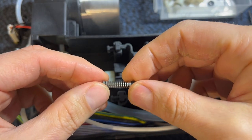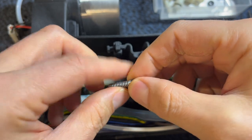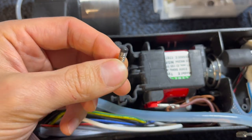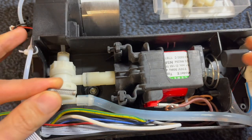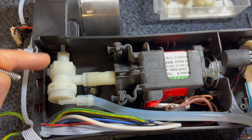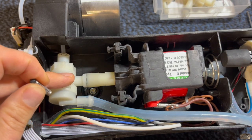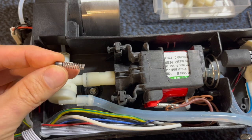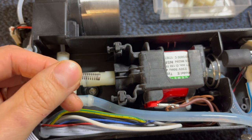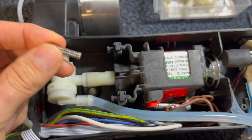First, I'd like to take the spring from the original OVP and put it into the new OVP to see how they compare. I measured this new OVP to max out at 11 bars, and I want to see if the old spring has lost some of its force by now. That will be the first test.